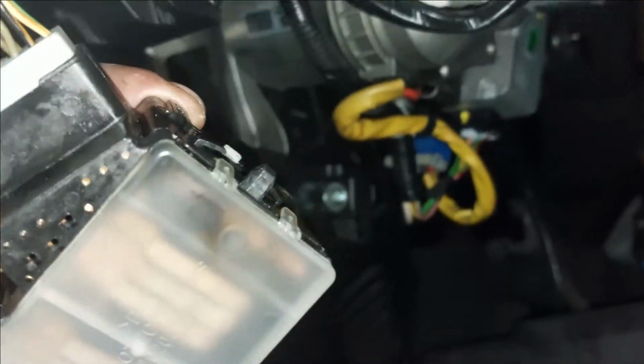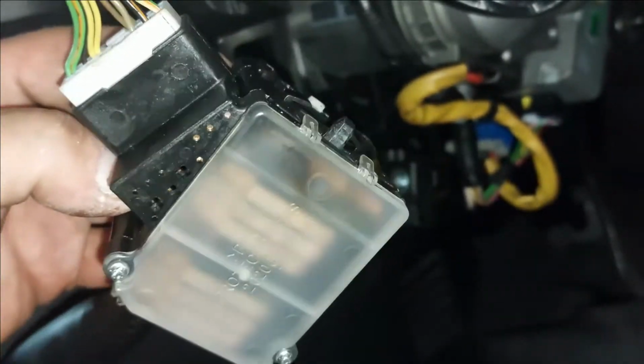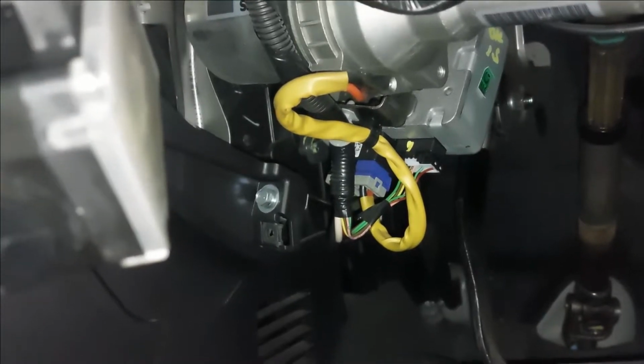So easy. Basically the grease was just creating a bit of resistance there, causing a path to the ground through the bulbs. The relay is quite sensitive, and it will start clicking as if I have a bulb missing.